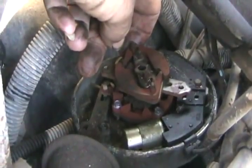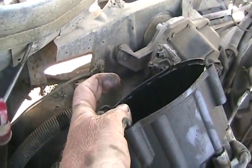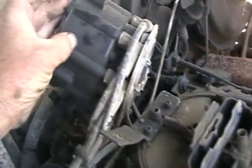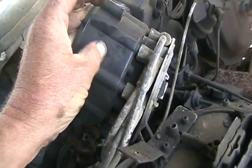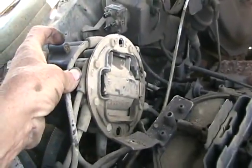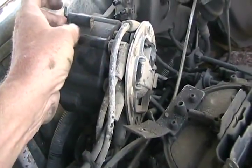It's not that hard to fix. That one looked really good — I just took a paper towel and took off the carbon dust. It's also a good idea to clean the outside of the distributor cap. If they collect dirt and oil, dirt conducts electricity, and sometimes they can arc between posts or down the side.